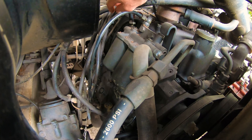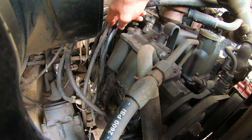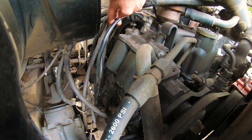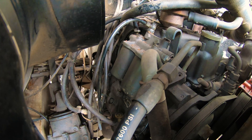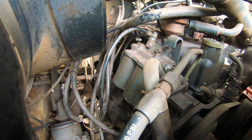This line here is the diesel return line — the diesel that doesn't get used by the engine gets sent back to the tank. At the moment we don't have separate return lines for oil and diesel, so when running on oil, the oil will be returning to the diesel tank. We're going to put a split in there to fix that.